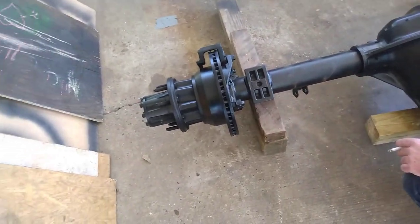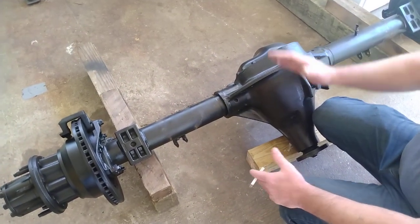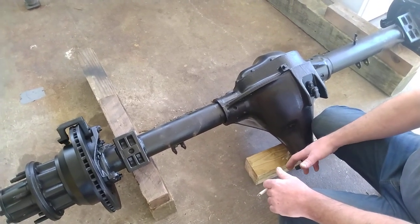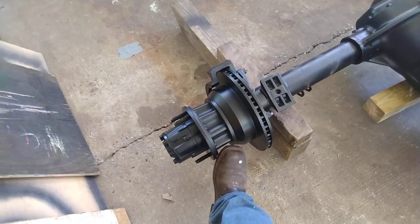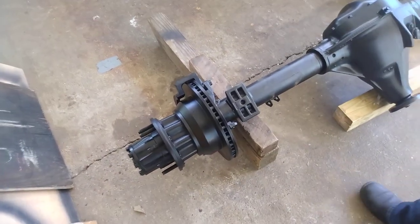So now we could possibly do away with our offset 16-by-10s and go back with 16-by-8-inch rims, and be able to rotate tires properly with a dually rear end that has a single wheel mount on the dually-style rear end.